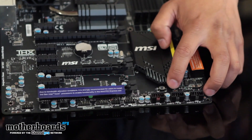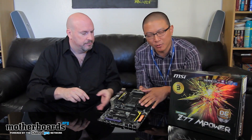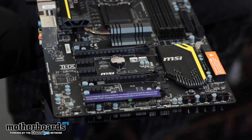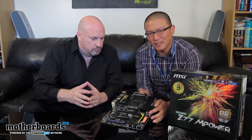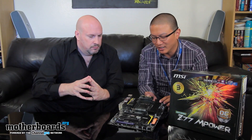And there's another little button right down here below — that's actually a 'Go to BIOS' button, a new feature we've introduced. As long as the board is plugged in and powered at the wall socket, you can push the button and the next time the board boots it will go straight to BIOS — you don't have to hit Delete. One of the main reasons for this is that if you have a RAID 0 SSD configuration, Windows 7 boots in less than 10 seconds, and Windows 8 can boot in under five seconds from shutdown. So if you're doing overclocking and tweaking settings, this comes in really handy.